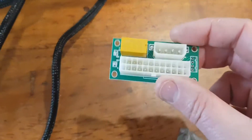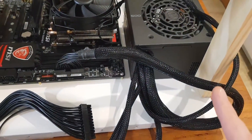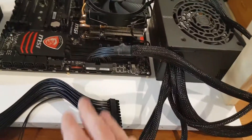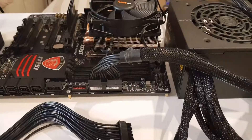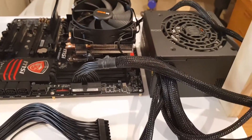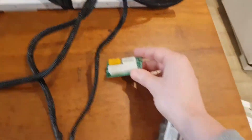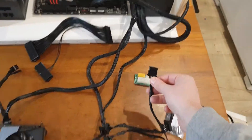The second alternative — you can get both these items on eBay for less than ten bucks, like seven or eight dollars. This is my new preferred way of connecting two PSUs. The reason I like this is you can just use a direct motherboard power cable into the motherboard. You're not putting any extra wires in there — some connections from eBay or China could carry a small amount of risk. So I like having the original cable from the PSU into the motherboard, and then we can use this little device which will power on via a Molex connector coming out of your PSU.